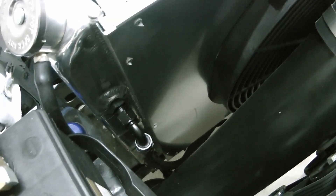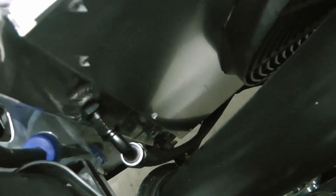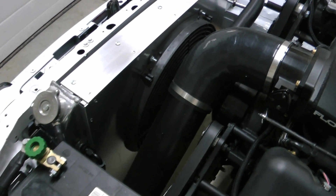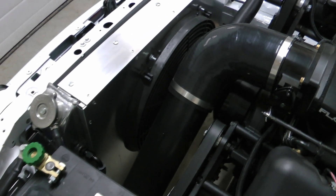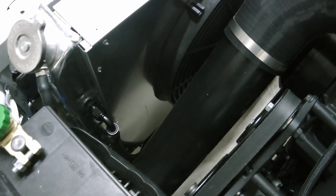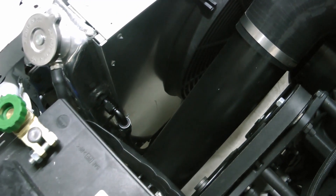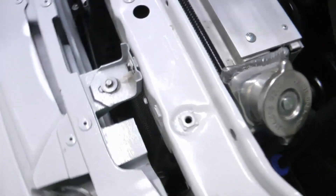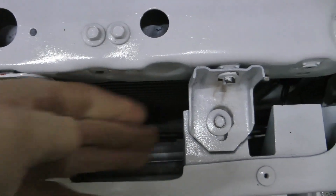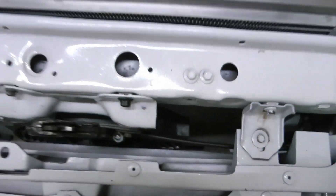The transmission cooler is actually integrated into the radiator. I've got two number-6 AN lines running back to the transmission. I haven't had overheating issues yet, though I don't have a gauge. If you're running a high-stall torque converter, you'll probably want an external transmission cooler. I didn't run one externally because there are only a couple fingers' worth of space available.